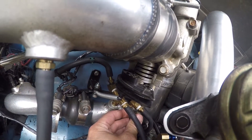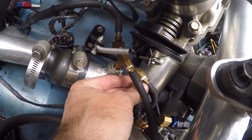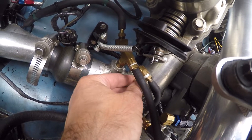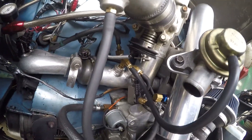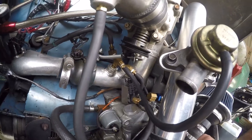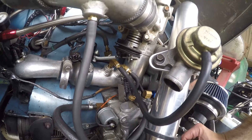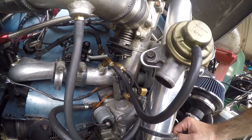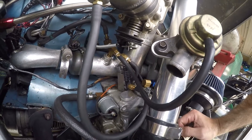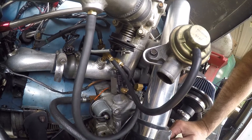What I've got here is a manual boost controller. It works by having a ball and a spring inside, and you just turn this little knob. I'm going to give it 32 clicks. There are about 98 clicks total up and down. On my previous spring, I had a 7-pound spring and could get about 14 to 15 pounds of pressure. Talking with my friend Warren at Anti-Lag Racing, he told me the boost controller is good for roughly doubling your spring pressure. So I've got a 14-pound spring in there now, and I'm hoping that with 32 clicks I can see about 15 to 16 pounds of boost.